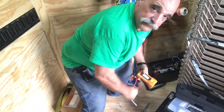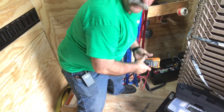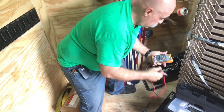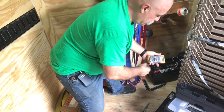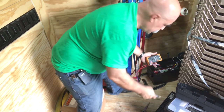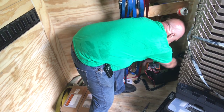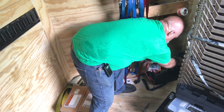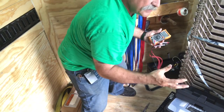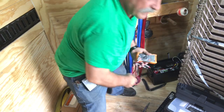This is the battery from the 'never buy a battery again' video. I had charged it up, but since then he's just been using it directly to take care of the lights. We're hooking up the seven pin to this battery. I want to show you where it is right now, even though he's been using it for weeks — it's at 12.17 volts, so it needs to be charged. It's operating the lights so it's not using a lot of power, but he's got a seven pin and he can charge this, so that's what we're going to do.